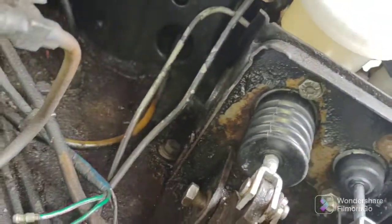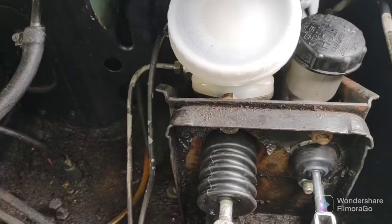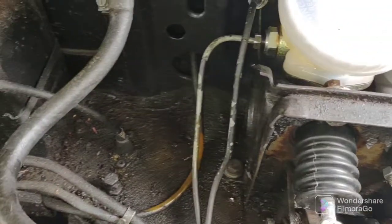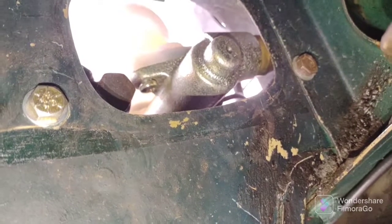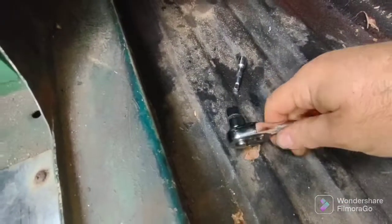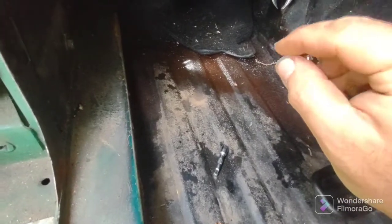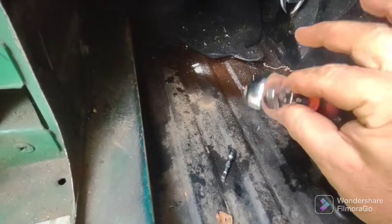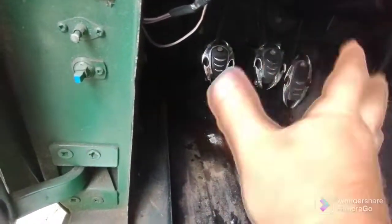Before tightening the under-hood bolts, I'm going to pull the bracket toward the footwell by tightening the two interior car bolts first. Then tighten these four down and the bracket is done. These two interior ones are 11 millimeters - quarter-inch drive. A little trick: if you want to start the screw, just use your hand. Put the socket on the bolt and turn it down until it gets a little tight. Otherwise you're going to be fighting the ratchet - the friction in the ratcheting mechanism will just have you turning back and forth getting nowhere. Get the bolt down manually first, then use the ratchet.